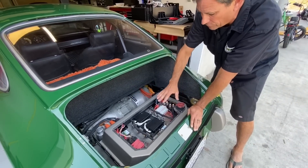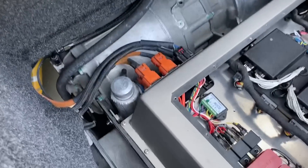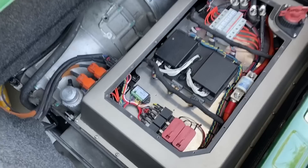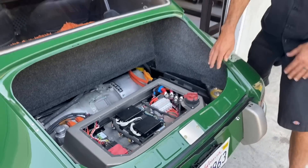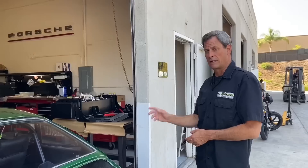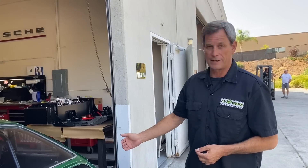This gives you an idea of the box and the cut-off switch. We've got our quick connectors over here, and this whole entire enclosure sits on a sub-frame that contains the Model S motor and our shaft adapters. The entire apparatus bolts in through the factory mount — it will go straight into your transmission mounts for your 915 or your G50 transmission, and then the rear engine mounts. We actually have both versions of this box: the 912 with the mounts a little bit further forward, and the 911 with the mounts back in the corner like this one.